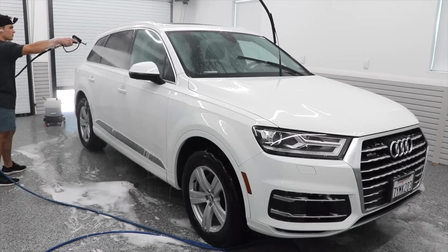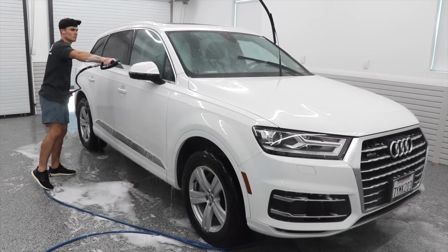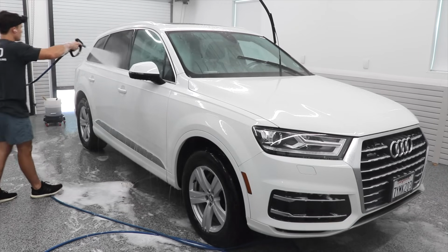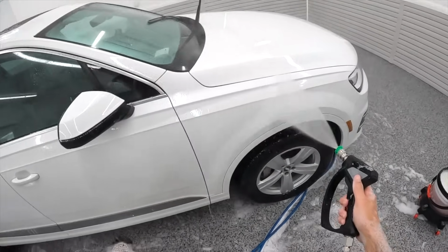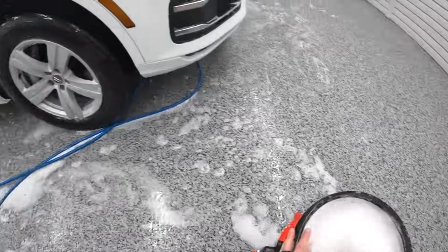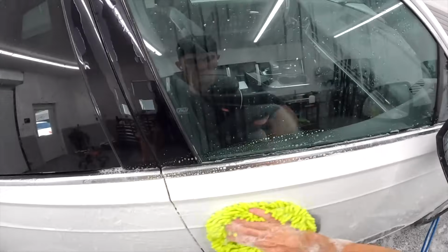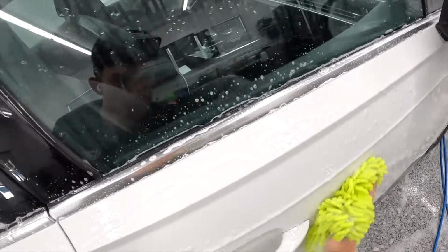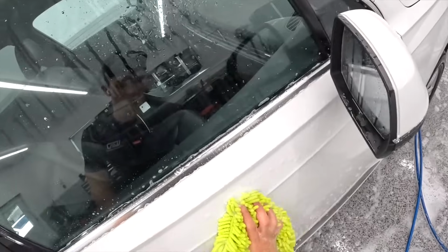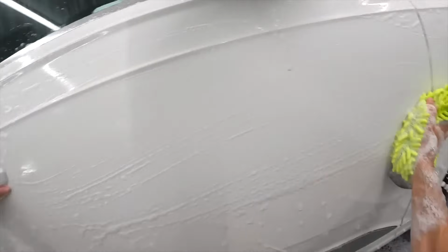I'm really liking the Muscle Magic because it goes head to head in terms of price with these other less expensive degreasers, and yet it actually is designed for automotive use. So at the proper dilutions, it becomes an extremely effective chemical that I'm really not very worried about. It also packs a great punch in the agitation wash for this particular Audi, where we had, in addition to that surface level grease, a lot of aphid residue, which is really sticky and can even be like tree sap. That was easily ripped off, not just from the pressure washer and the foam cannon wash, but in the agitation wash, the last bit of that residue was pulled off as well.